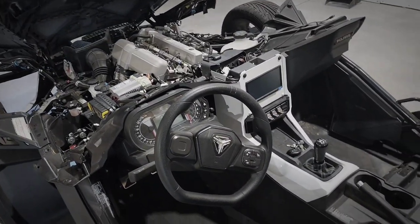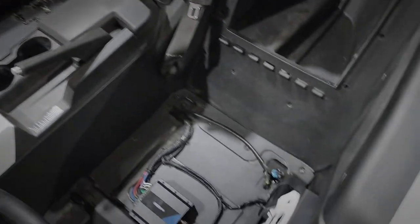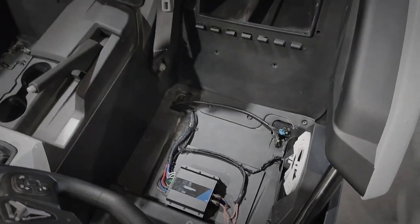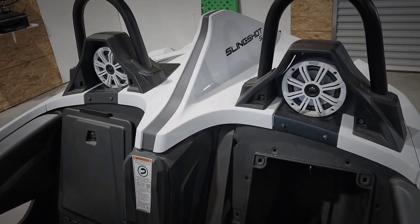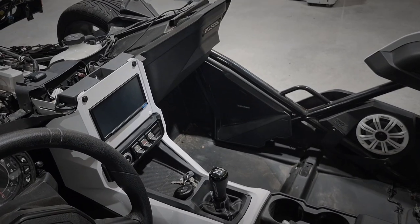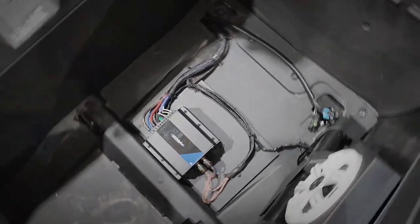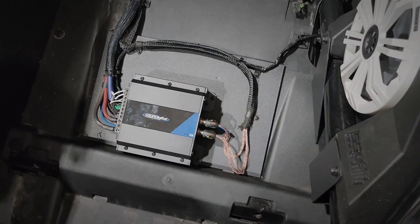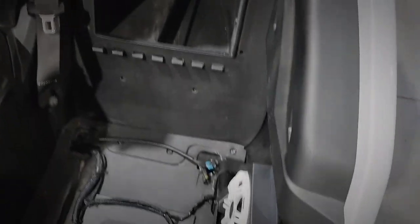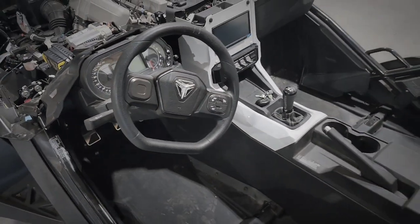We have it pretty well buttoned up and done. All I've got left is to put the dash and the seats back on. Just got done testing it — everything works perfectly. It's actually very loud. Those speakers on the side — I really didn't have much faith in the placement, but it adds a lot of output. He's got the Kicker six-and-a-half marines on the sides, the six-and-a-half marines in the rear, the factory Fosgate woofers in front, and tweeters that are part of the dash. I have the rears and sides parallel together off the rear output, and the fronts running up to the kicks.